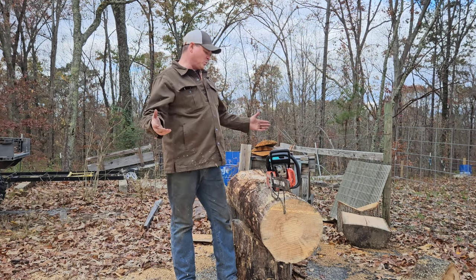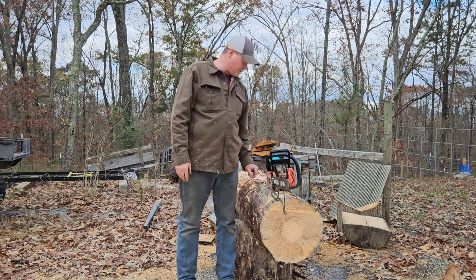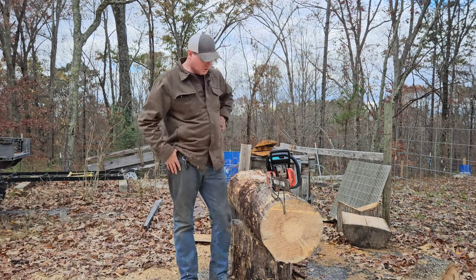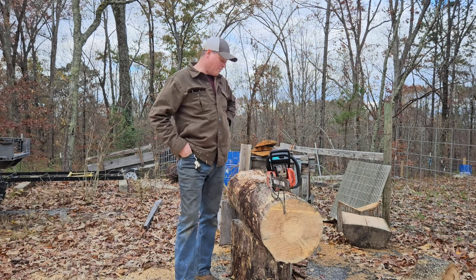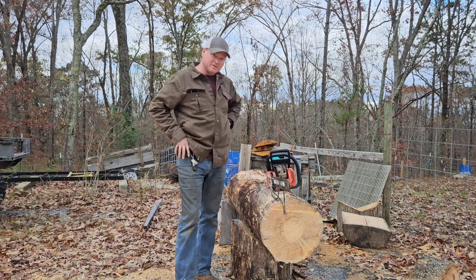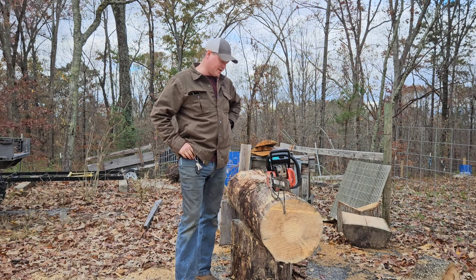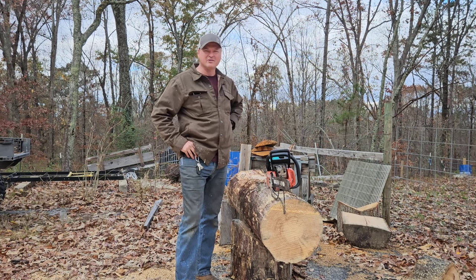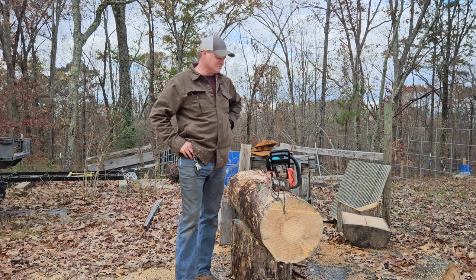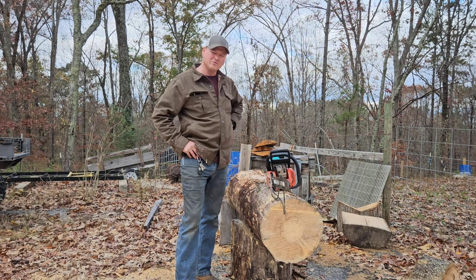What do I think about the port job? Definitely feel like I lost a little bit of torque. And that sucks. Didn't want to do that. But that's what happens whenever you make mistakes, right? We all make mistakes from time to time. And I definitely made one on this. I did not mean to go 115 on the transfers. 124 or 122 was where I think that it would be good.